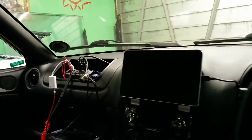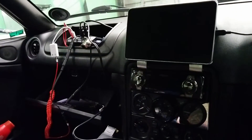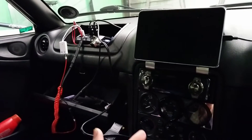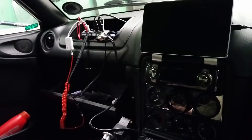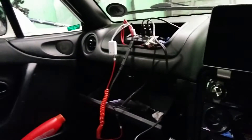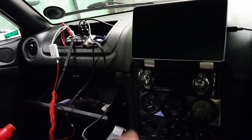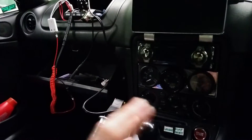Right, a bit of an update on the Nexus 7 install. What's been bugging me for a while now is the auxiliary input. When you try to use a Y-splitter so you can still have normal auxiliary inputs, the sound distorts to one or two speakers. Essentially you just can't have digital sound and a normal auxiliary at the same time, and you need one of them unplugged.